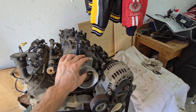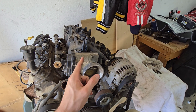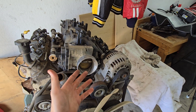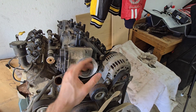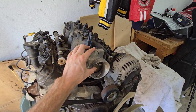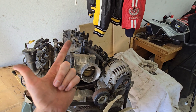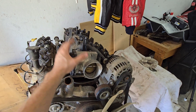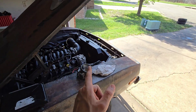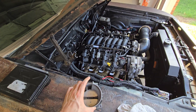When you have issues on your swap getting it started and you're running drive-by-wire, nine times out of ten that is the culprit. Even back in the 2000s, the drive-by-wire setups on trucks and SUVs had issues — you'd have to replace the whole throttle body because it could randomly not start or shut off while driving. Drive-by-cable is always my go-to and always recommended.